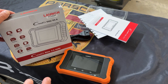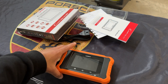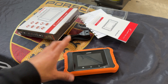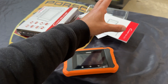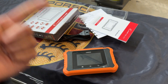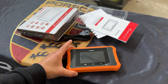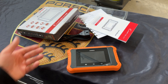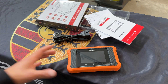Right out of the box, why do I love this scanner? Well for one, it's very budget friendly. Imagine getting a bi-directional scanner for less than $200 — that's a great deal. Bi-directional is important because you can push info in but pull info out, meaning you can do active tests, resets, and ECU coding. You can do quite a bit with a budget friendly device like this compared to something else that's $200 that really only reads your trouble codes.